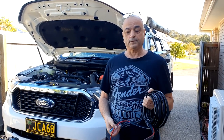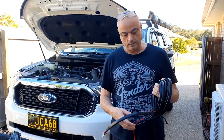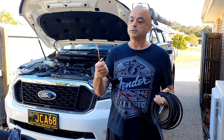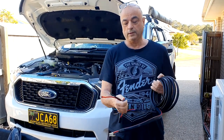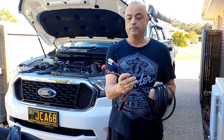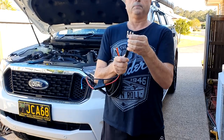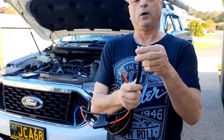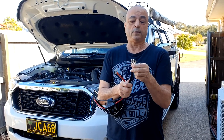Today we install our KickAss dual battery system. The main tip for installing is: run your wires first, then connect the plus and minus to the battery. If you connect to the battery first you can cause sparks. They've got an Anderson plug you can plug in, but you don't want the plus and minus terminals touching each other — they'll short out.